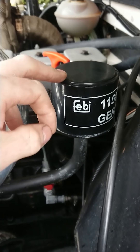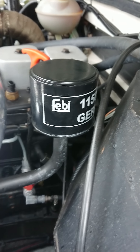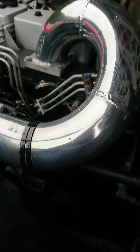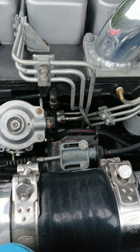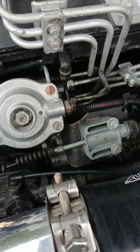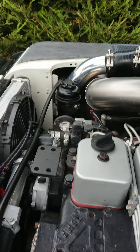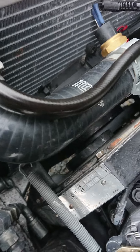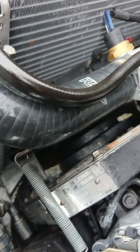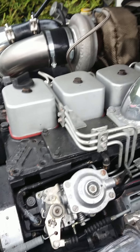The intake is off — I think it's actually off a Volvo lorry. That's our intake suppressor silencer and it works really well. The power steering pump on the lorry is quite high pressure, so you can get a reduction spring to drop the pressure down, and basically just feed the high pressure side of the pump into the Land Rover steering box, running a normal Land Rover reservoir. Works fine. The pipes run down just in front of the engine — they're very close to the damper pulley, so I've tied them up quite well and put a wee plate over them, just in case the engine moves forward under braking.